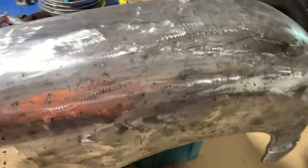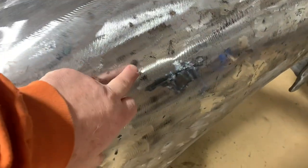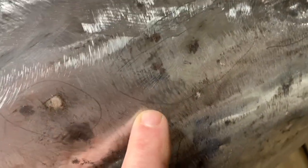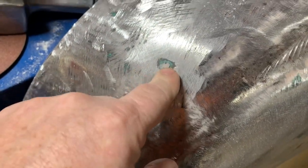This is the 55 Chevy pickup truck's rear fender. Everything you see there that's dark was a dent — it was terrible. I've got most of them smooth. You can see where I've circled a few more that I need to work on with a graphite pencil, and this will be okay to do body work over — it won't bleed through later. Most of them that I've dollied out, I've gone back and knocked them down. Most of them look just like that right there — I dollied them out from behind with a hammer and a dolly and did all of my metal work.